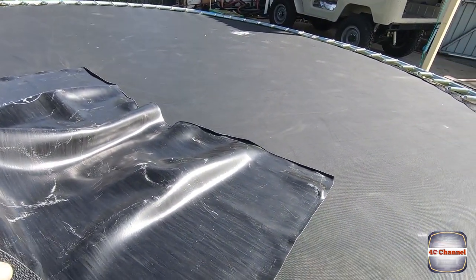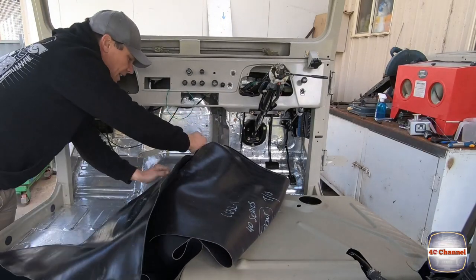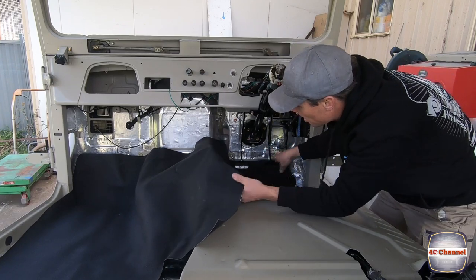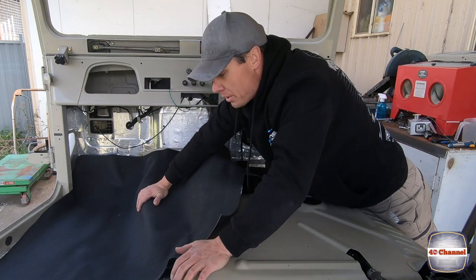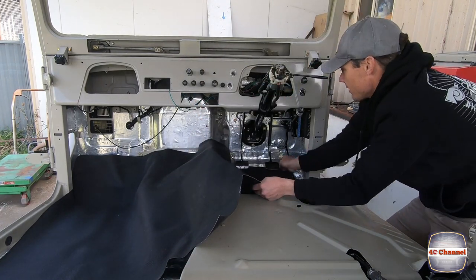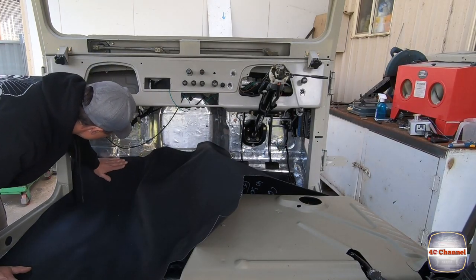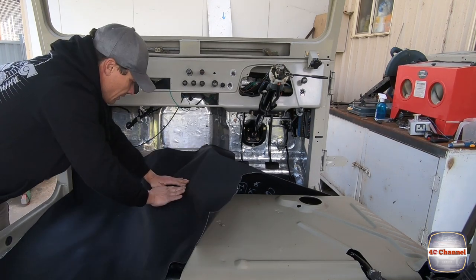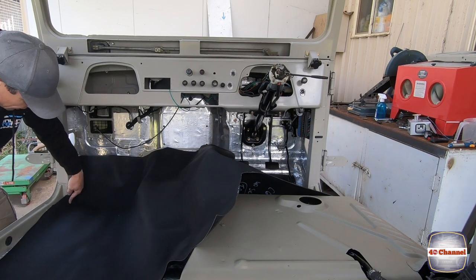I've just had it sitting here in the sun just to soften it right up because it's been quite cold here. I've just removed the gear stick, we might drop the rig lever down and get our position right. It sits right up against the firewall there. If it's still really cold, you can get a hair dryer or heat gun and just work your way over it to soften it up and mould it around everything. You're not going to hurt it by doing that. Now we can see it comes up to that point there, which follows that line across there. That's cut out nicely - that's our first hole right there for our gear stick lever.